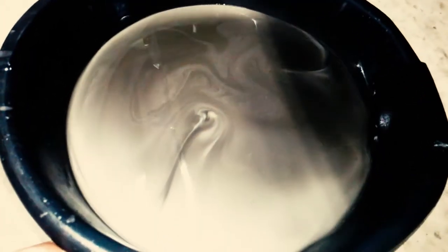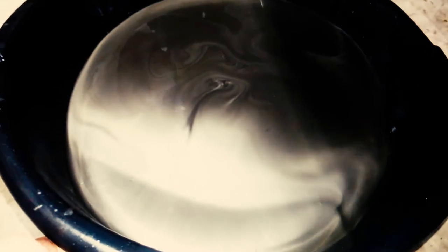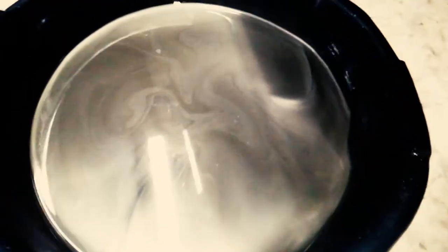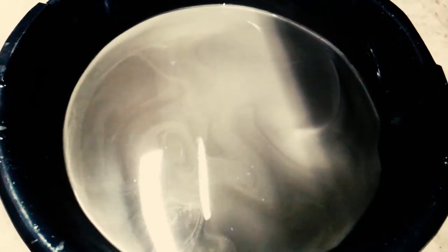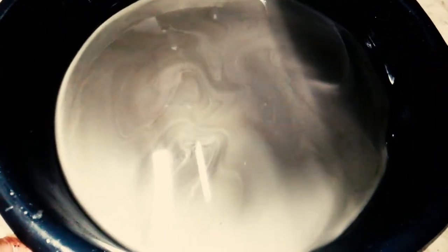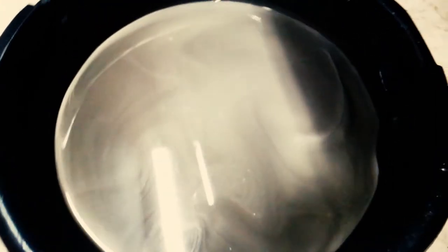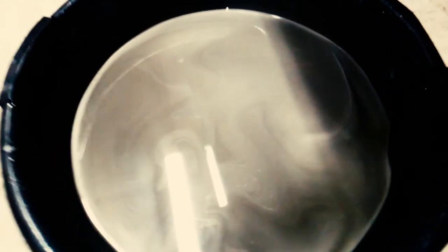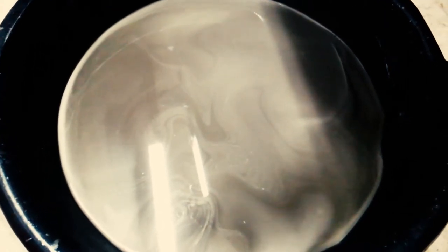Here's the oil drain from the M205. It's been 5,000 miles so I drained it because the break-in period was up. No noise, drivability is fine, but it comes out silver, which leads me to believe something aluminum is broken or rubbing. No metal flakes, nothing much on the magnet — nothing more than what you'd expect from typical break-in with brand new gears and bearings.